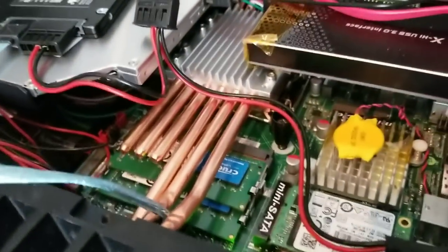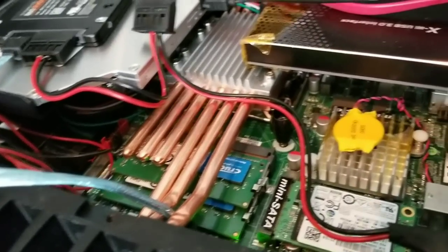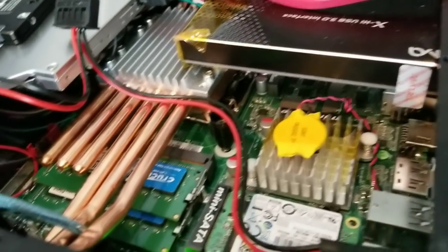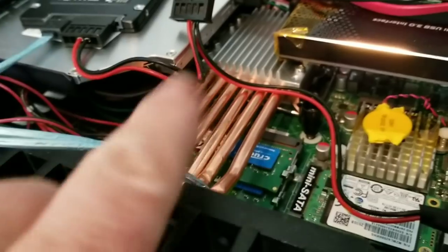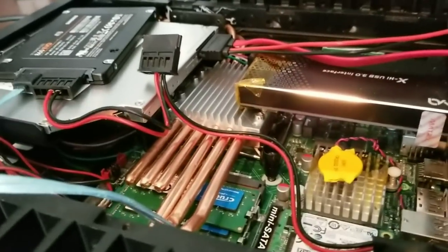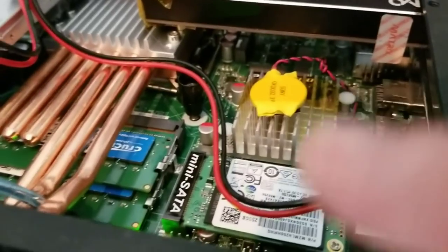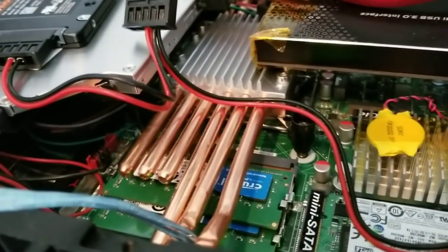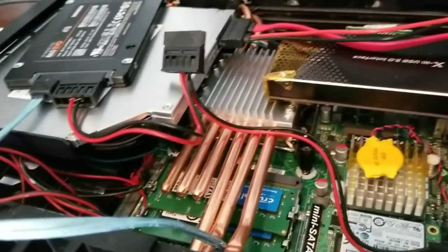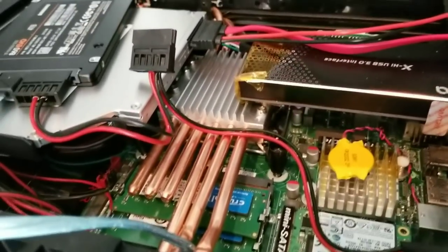So it's all powered externally — it's going to be quiet and do the heavy lifting. I would not normally use this as my player because something this powerful, like an i5, is going to be noisy. There are ways to deal with that — I've got RF absorptive material I put in here to quiet some of the parts. You lay this absorptive material on top of the chips and it absorbs noise. I've had builds that are both server and renderer in the same box.